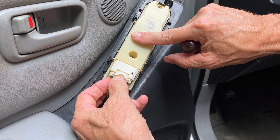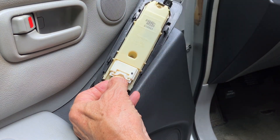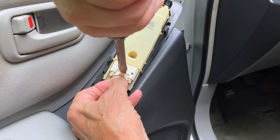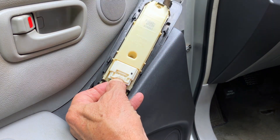The reason you do not want to pry from the bottom is that you will break that off. To get the wiring harness out, there's a release tab right here, and I've been working on this for a minute or so and it just will not come out. So I have a large flat head screwdriver — I'm going to press in on that tab and then twist the screwdriver. There we go.